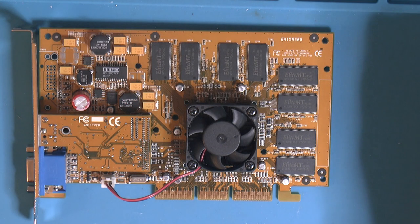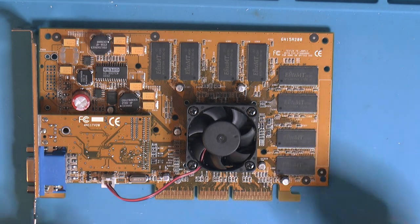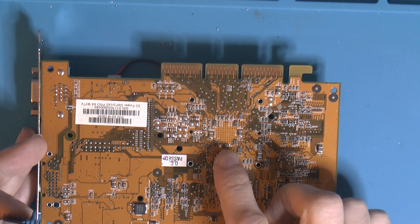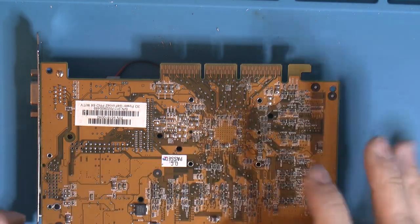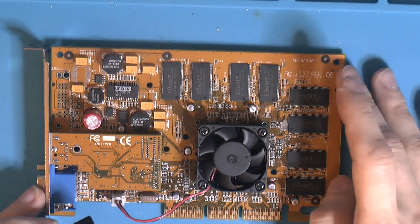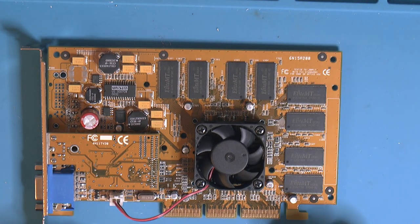Another thing I'd like to do with this card is add some RAM heatsinks — not because the RAM needs cooling or overclocking, but because the GPU heatsink is so small the card gets fairly warm. I think the memory runs around 50°C. These old chips are actually cooled largely by the PCB — the balls in the middle connect to ground and that's used for cooling, so the PCB is like part of the heatsink. Because we have such a small heatsink on the GPU on top, a lot of cooling is done by the actual PCB. So if we cool the memory, we cool the PCB, and therefore we cool the GPU.